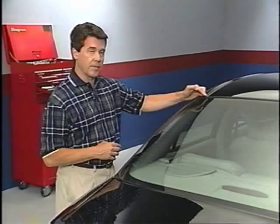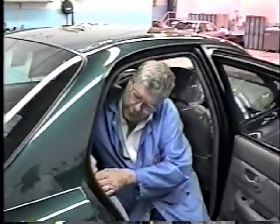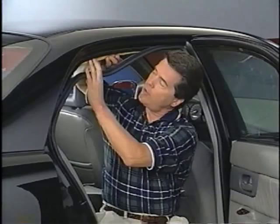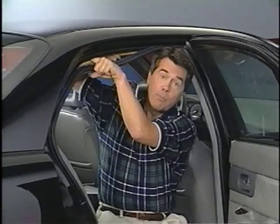You can trace the path of the interior leak by feeling for water here, below the sail panel, beside the rear seat. To check for a leak at the ditch seal, loosen the door seal a little. Remove the coat hook and carefully pull back the headliner enough so you can get the compressed air nozzle into the body panel below the ditch molding.